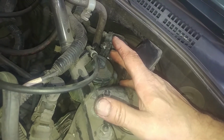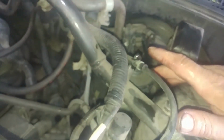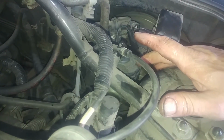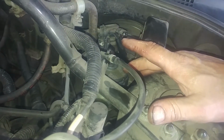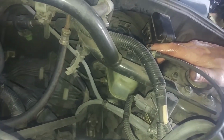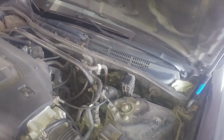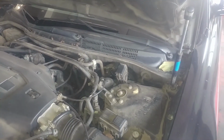When you're collapsing your pistons, you want to maybe just make sure fluid doesn't flow out of here. Brake fluid can damage paint, so if you want to keep things clean, you can maybe suck a little out with a clean rag or a turkey baster or something. Just keep an eye on it when you're collapsing pistons. And then top it off a bit if you took some out, and then pump the brake pedal a few times when you're done. Set the brakes in their proper spot. That'll set the brake fluid to where it needs to be, and then you can add or subtract as needed your fluid here. So that's basics on the master cylinder and your Acura 3.2 TL. Good luck to you.